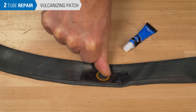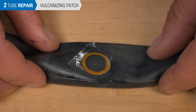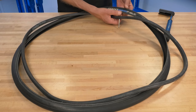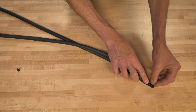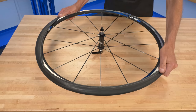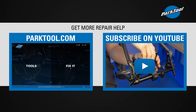Leave the clear plastic cover on the patch — it reduces friction and rubbing on the new patch. After a minute or two, inspect the bond of the patch to the tube, seeing that the edges look adhered to the tube surface. The tube is ready to be installed in the tire or packed away as a spare for the next ride. When packing a repaired tube, bleed out the air as you roll it up to keep the size to a minimum. If you need help reinstalling the tube, see this video. And that's the basic process of how to repair a bicycle inner tube. Thanks for watching, and be sure to subscribe for the latest videos from Park Tool.